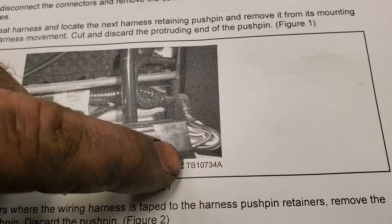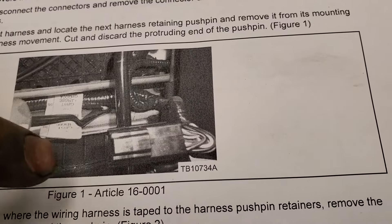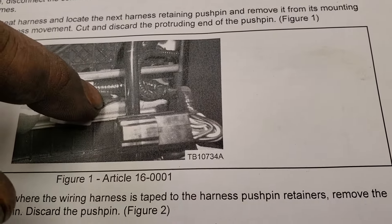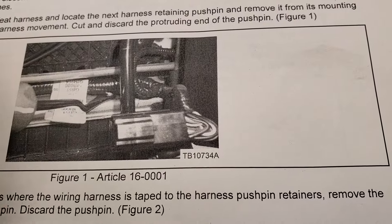So, in a pinch, when we haven't been able to get the wiring harness right away, I've unconnected this connector, popped it out, gave it some looseness so it was free, cleaned everything, dielectric greased, and put it all back together. And before this TSB even came out, I would do that - clean everything, put it together - and the light would never come back on again.